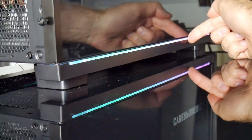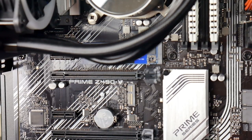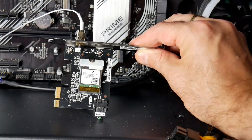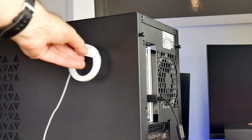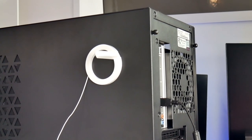There is also an RGB light bar at the bottom, which is nice. CyberPower uses an ASUS Prime Z490V motherboard that supports up to 4266MHz RAM, has two PCI Express x16 slots and four PCI Express x1 slots. The MSI Ventus is a double-slot card, which still gives you room for expansion even with the included ASUS PCI Express Wi-Fi card, whose antenna attaches magnetically to the chassis — though I find the wireless strength to be pretty poor, although my access point is one floor above me.